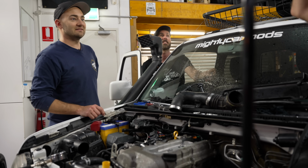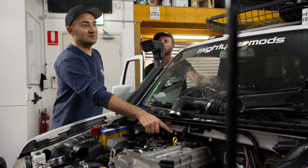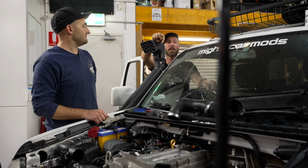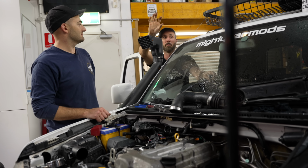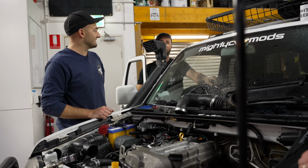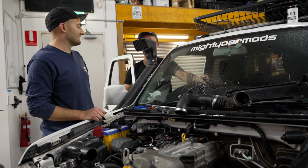And it went sweat. Yeah, so that had a cylinder full of water and the others just had a little bit of schmutz. But also, when we took the spark plugs out before, it was that spark plug that was all burnt and all boned. That's it. So cylinder 4's cracked. Yeah, it's got to be. Quite an issue.